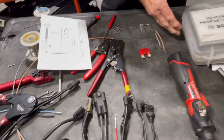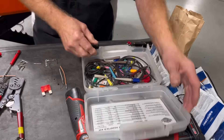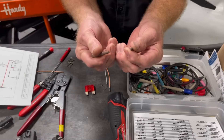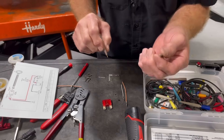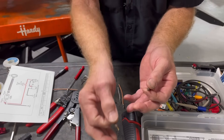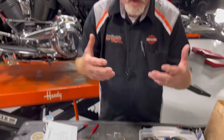We have a fantastic kit — it has every terminal connection inside — so we can take ours, try to put it into the connector on both the female side and the male side, and feel how much draw there is. Is there resistance pulling in and out, or is it loose? Now, when you have a connector with, say, six terminals inside, there can be just one that is a little bit loose. So how do you do that?